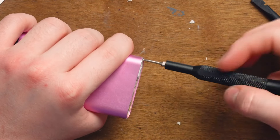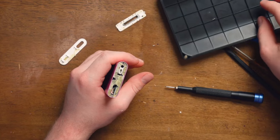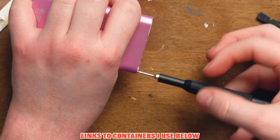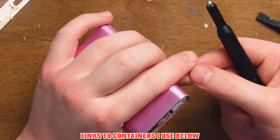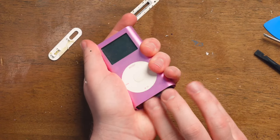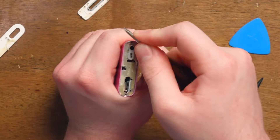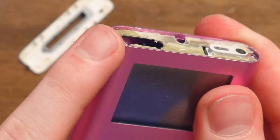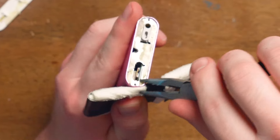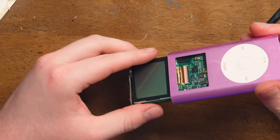That's the click wheel ribbon. Then there's two screws at the top, and after that the guts should just slide straight out of the iPod. I have lost enough little screws to make sure I'm extra careful — it's really annoying when there's a little screw that you need and it's just somewhere in the carpet. It's never as simple as people make it look in YouTube videos, is it? Apparently if there's any dents — and this one surely has dents — that makes it a lot more difficult to slide out. That is most certainly not perfectly rounded; it's a little bit compressed. This is a thing I made that I have in my drawer — just paper towels and tape — so I don't destroy the case any more than it needs to be. That's what did it: patience, and not brute forcing anything, because I didn't want to break it.